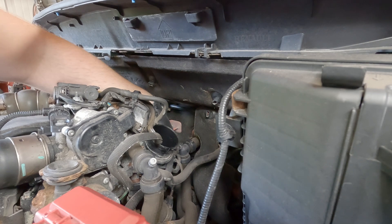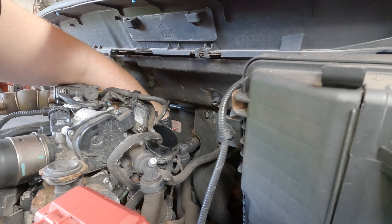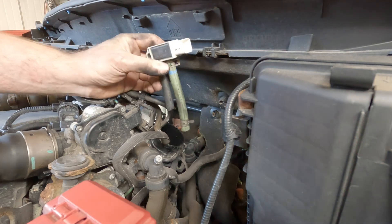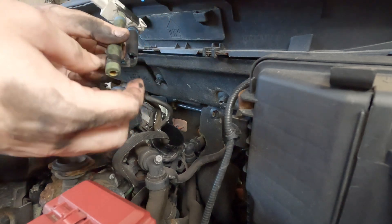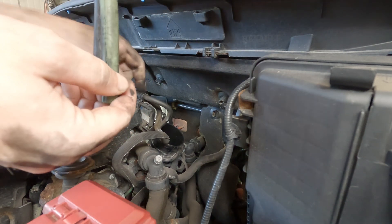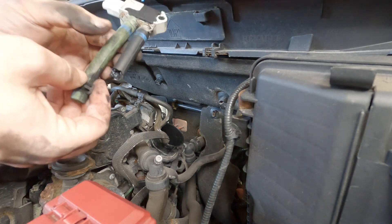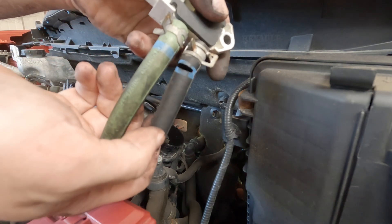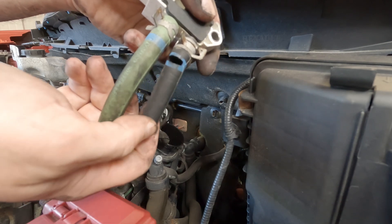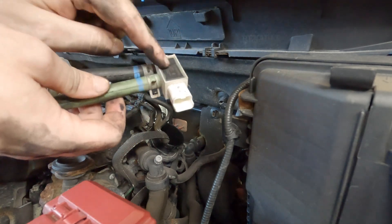Now it's just these pipes. These rubber pipes are being held on by little spring clips. You can just squeeze them together with your hands if you can get on them nicely. Here the pipe is out. These clips are a nightmare because half the time they're positioned the wrong way around so you can't get on them nice — you're going to have to try and push to guide them around and then give them a squeeze. You can see here this black pipe is completely detached from this section, and there's another split there.